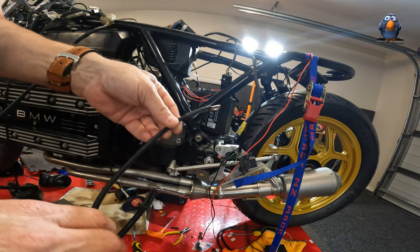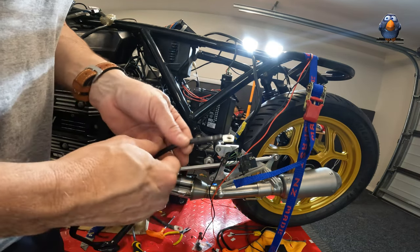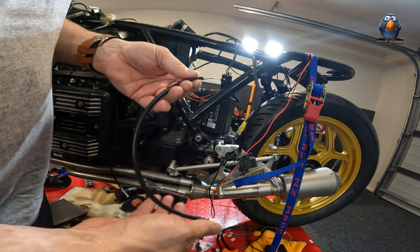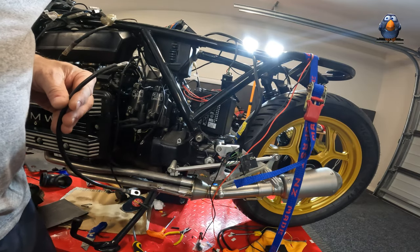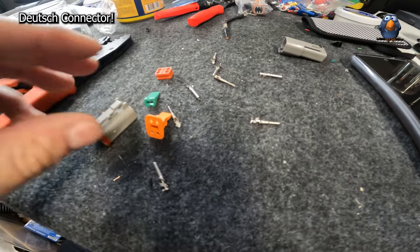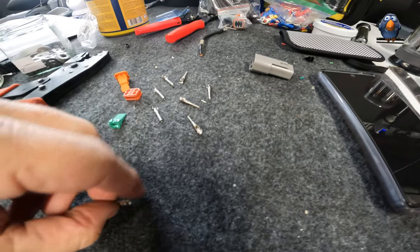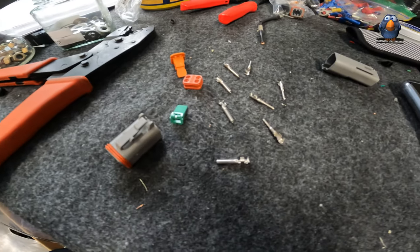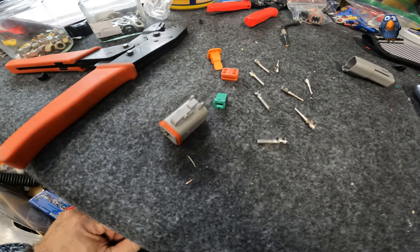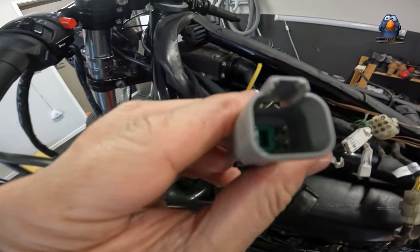For the primary ground I've used a much bigger wire - I'm using eight gauge wire. I've seen guys use four gauge and six gauge and I think that's ridiculous. This is bigger than what I had before so it must be good enough. I've got larger terminals, thicker gauge and hopefully that'll work well. I'm going to try a thing called a Deutsch connector - they look quite robust and waterproof. I'm going to try these on the run, stop, start and kill switch and see how they go. If they're better than these plastic things which are not waterproof, I might shift onto these. Let me see if I can do them - they look like they need a special tool but I'll try the normal tool.